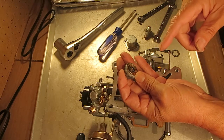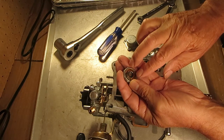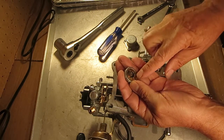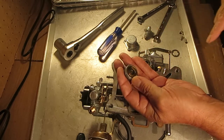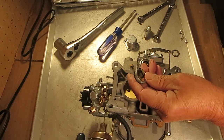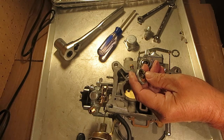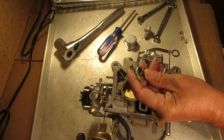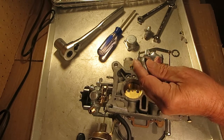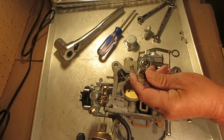One other thing: the numbers on the valve — there's a 7 here and a 5 here at a 45-degree angle, that means it's a 7.5. If you have an 8 and a 5, that's 8.5. That's how you tell by the two numbers. Typically your atmospheric vacuum will be around 15 inches at the carburetor, and half of 15 is 7.5 — that's how you select the right power valve. So if you measure vacuum at the carburetor and it's 15, you need a 7.5 power valve.